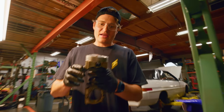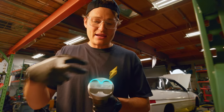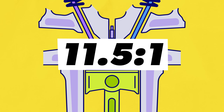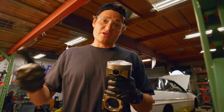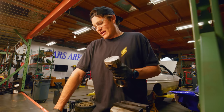The pistons have a couple of notable features. The first is four cuts in the top of the piston that correspond to the four valves per cylinder — two intake and two exhaust. We also have a raised dome top, which helps create our compression ratio of 11.5 to 1. Compression ratio is the ratio of the volume inside the cylinder when the piston is at bottom dead center compared to when it's at top dead center. A higher compression ratio means more power and better fuel efficiency.